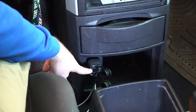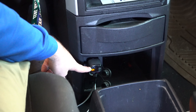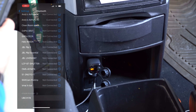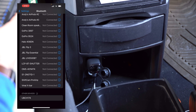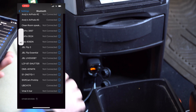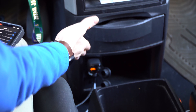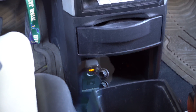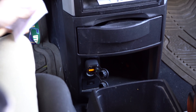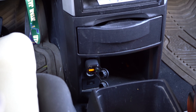You can see here we've got lights blinking, which means the Bluetooth connection is not there yet, so we need to set up a Bluetooth connection. Sharing my screen — you've got the UBCH UB Channel 174, click on that, and you're going to see it change from blinking to solid. We're now connected and my audio is being displayed to the device. Now we need to pick a channel — we need to change it to a frequency that's not being used. I've changed it to a local FM frequency. You push the channel button and then twist the knob to the associated specific channel, so we're moving it to 87.9.